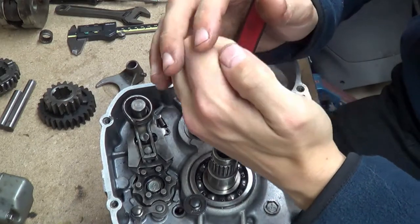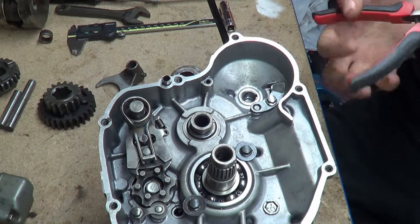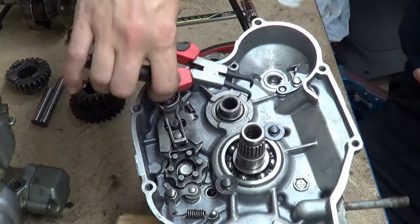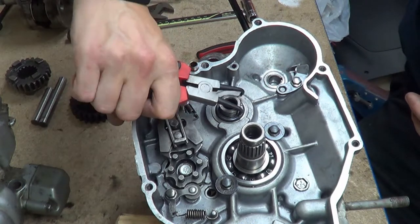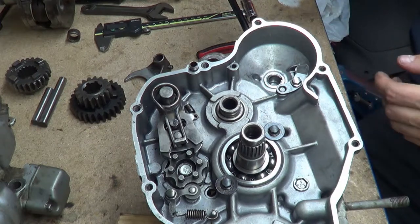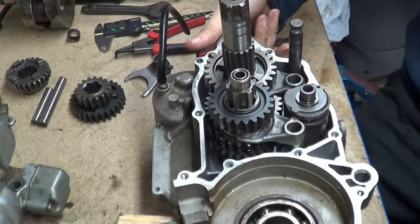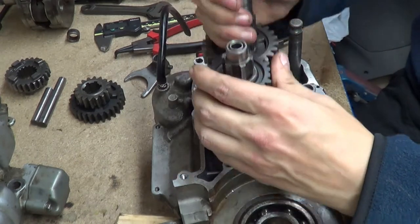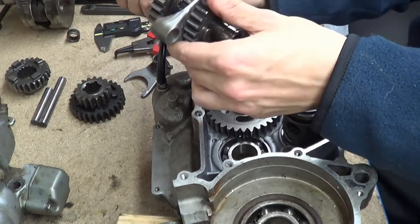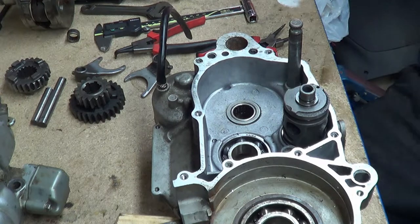The circlip is a challenge - I've got the wrong circlip pliers. Obviously doing the reverse, so you don't fire it on like I just fired it off. Turn it over and the shaft should move - this shaft wants to come out and just like that, you've got it in two assemblies. Then you're left with the movable gear and the forks - put that back on. That's your first output shaft, first gear. Take that off with the selector fork and you're left with an empty casing.